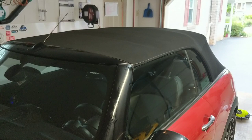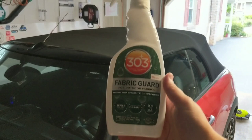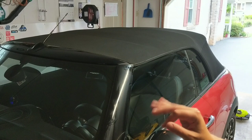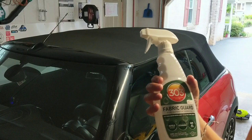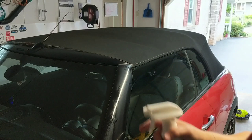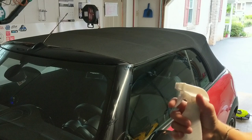We're on the tail end of the detail — inside is done, outside sealant is setting up, and we're going to work on the fabric top. With the 303 Fabric Guard, make sure you apply it when the weather cooperates. You don't want rain on it for a minimum of 12 hours, ideally 24 — otherwise you might have rippling or the product might just wash off. If it's going to rain and the customer is passionate about having it done, just reschedule for another day.